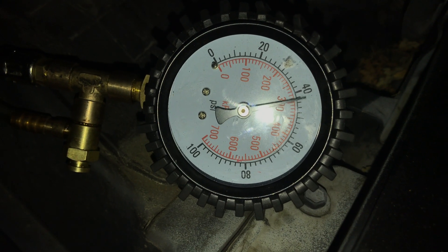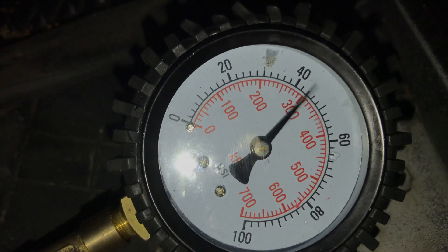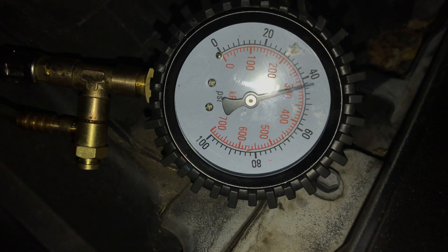Still the same pressure. With this gauge you can even let a little fuel out to make sure it's flowing. Oh, now we're bouncing — but that may have to do with draining a little fuel there. That could be indicative of something though; if I'm getting fuel pressure kicking around, maybe that's why I'm having this issue.